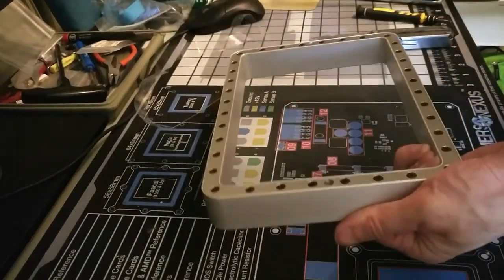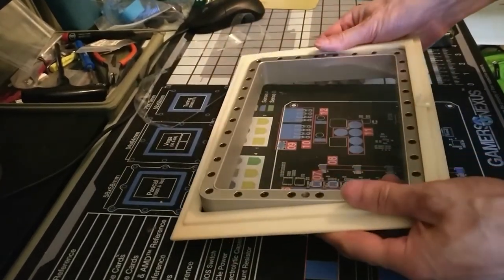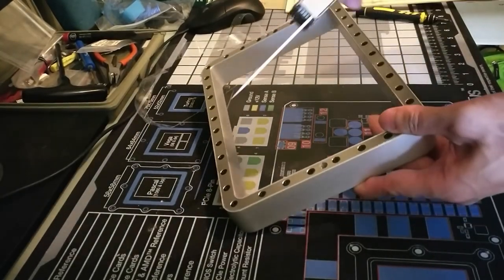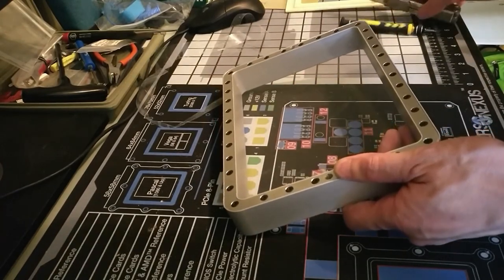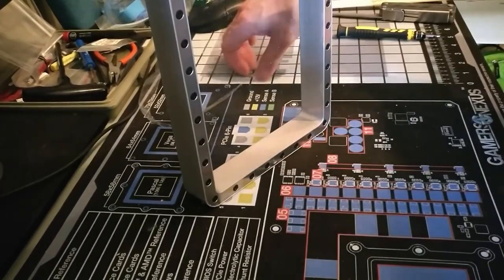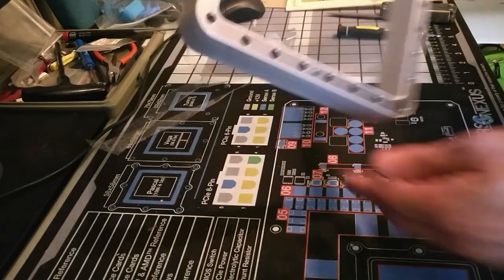Alright, I found out using this FEP installer thing to cut against wasn't very useful, so I just used a knife and cut along this outer ring, the metal. That was easy enough. And there you go, the installation of new FEP film on a Phrozen Shuffle vat.